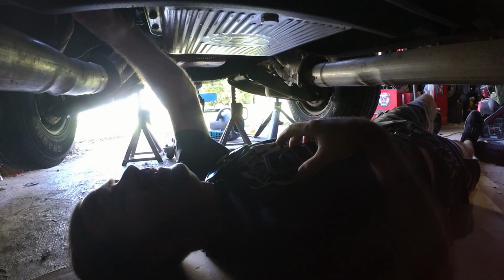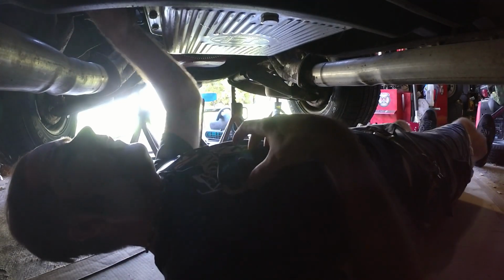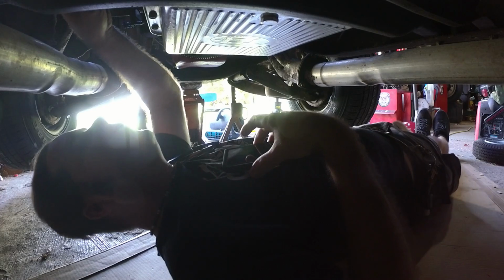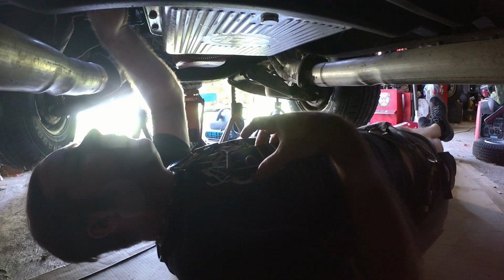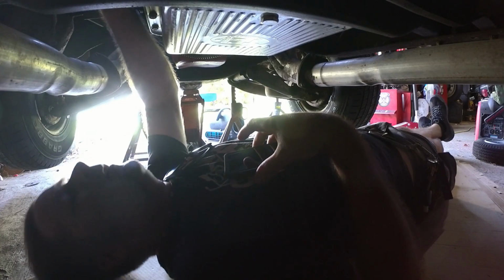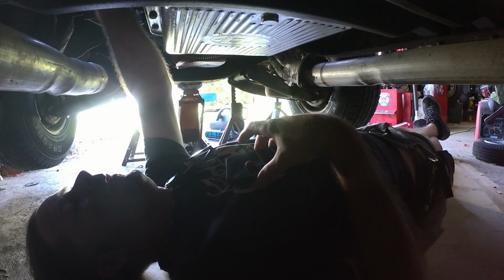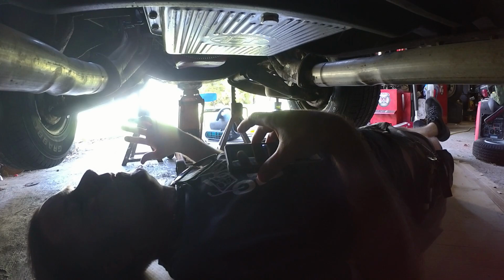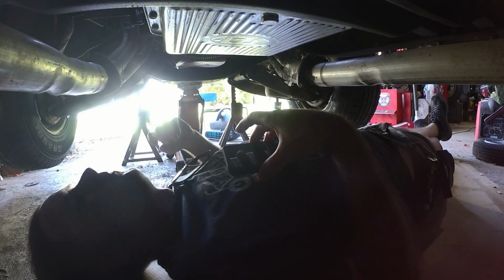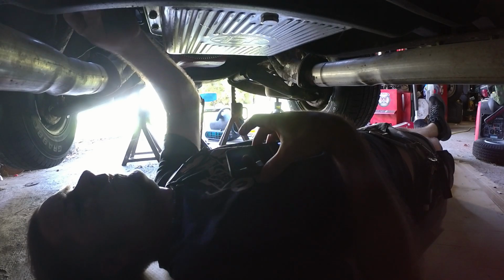And then hook vacuum off of the manifold or carburetor, whichever you want. Well, it already has some sort of a vacuum switch on your transmission, with a black wire coming off of it. You hook vacuum to that little port on that. Yeah, it's got vacuum on it. I've been driving this thing around for like a year now without the lockup hooked up. Okay. Well, 12 volts to the red wire and vacuum to that switch will lock it up in fourth gear.